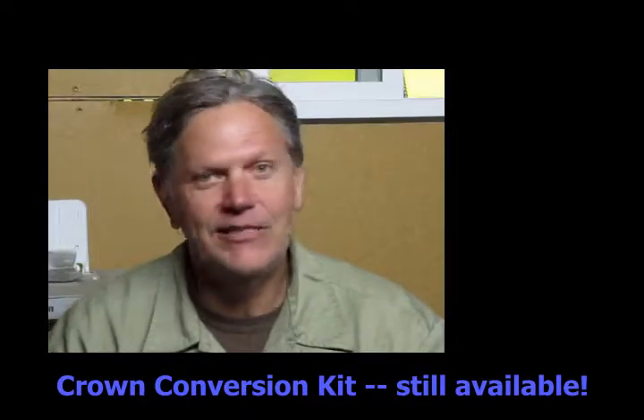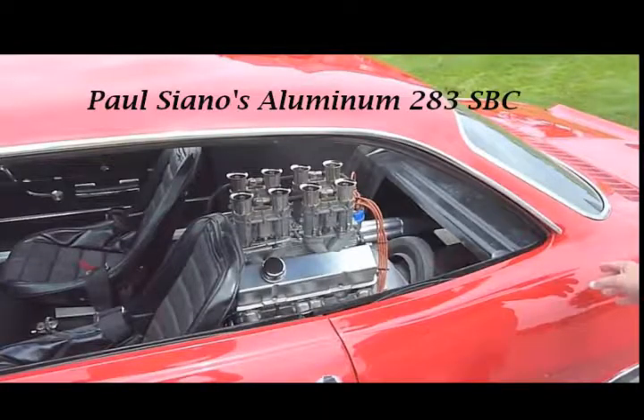The problem with those kits, if you've ever seen them, is that the engine ends up sticking way forward and you've got to scoot the seat way up — it works great if you don't have any feet. It's a really tight fit and extremely loud and noisy, all the ones I've seen. An Audi V8 is actually really suited to this conversion because it's really short. A small block Chevy is about 27 inches in length, but Audi made their engine only 22 inches long.